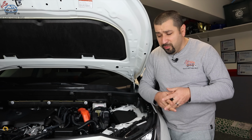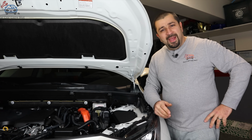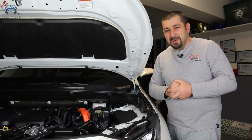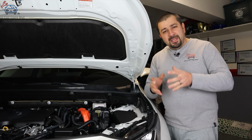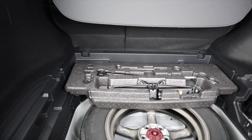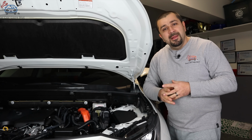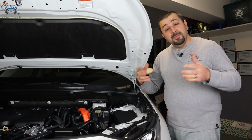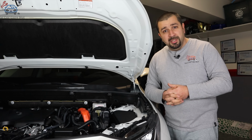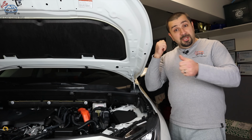And as a bonus for sticking this long for this video, which I really appreciate, let me show you how you actually can jumpstart your own hybrid, not give jump starts to other people. Now, most hybrids, except the 2016 and up 4th generation Prius, have their batteries all the way in the back. That's by design, because you have a new component that takes more space. In the new Prius, they made space and were able to put the battery under the hood. But everything else, the battery is in the back, either in the trunk or in the hatch area, as in the case of this one.